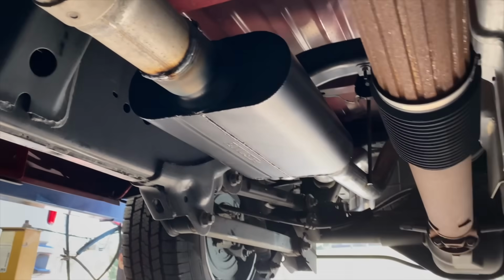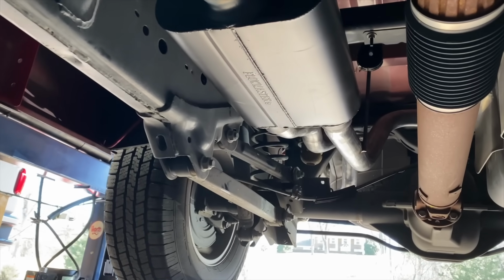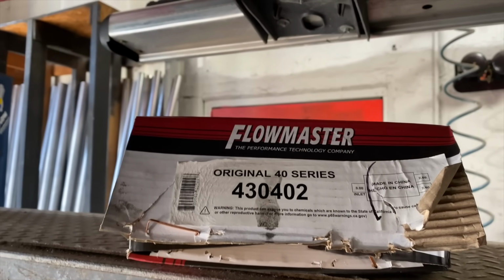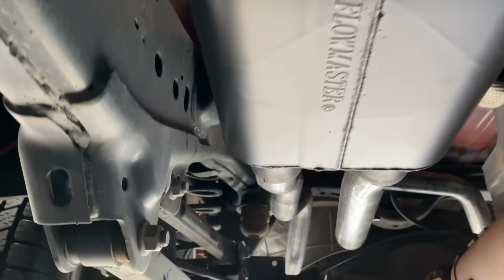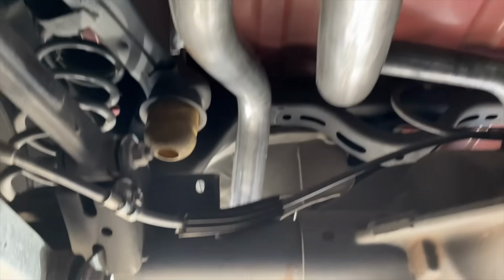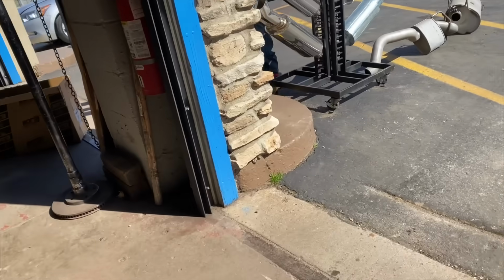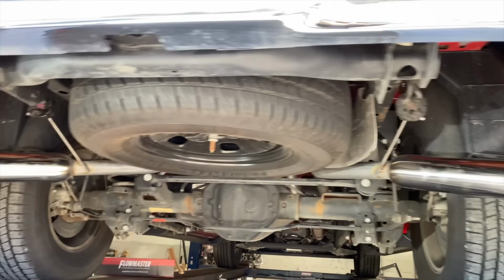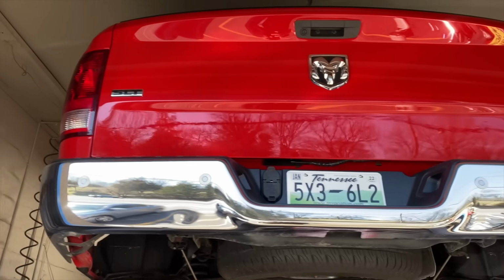And then we put a Flowmaster 40 series, single in, dual out, 3-inch to 2.5. Part number 430402. We'll have a link in the description for it for you guys. Then 2 tailpipes, mandrel bent, 2.25 on each side. There and there. Into 4-inch roll tips. Right there. And right there. SLT, Dodge Ram Classic.